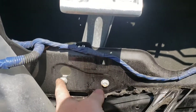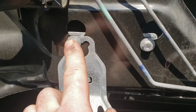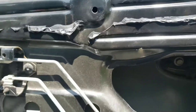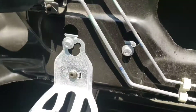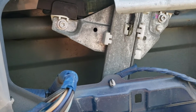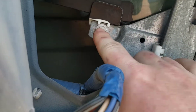You need to remove these two bolts here and these two bolts here — that gets the track and motor out of the way. Then the window needs to come down, and in here or reaching up, there are two more 10 millimeter bolts that hold the glass onto the track. I'm going to undo those and pull the track out. If you're lucky like me and the motor is broken, the window can freely go up and down so you can remove these two bolts easily and remove the window from the track.